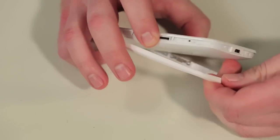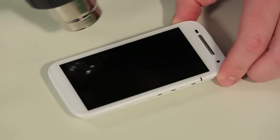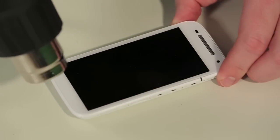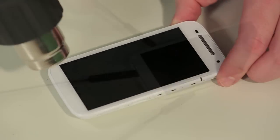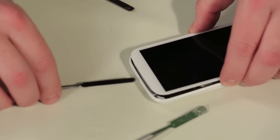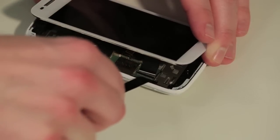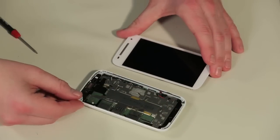After removing the phone's plastic rim, we can use a heat gun, hair dryer, microwavable warmer, or other heating device to warm the edges of the front panel just enough to loosen the glue that holds it to the plastic body. Then gently pry the front panel and display assembly away from the body, disconnect its ribbon cable, and ultimately set it aside.